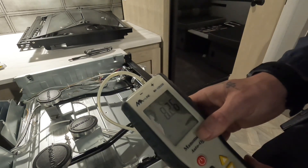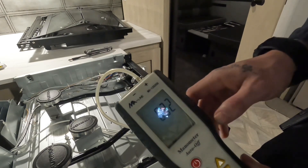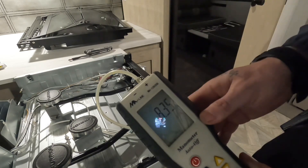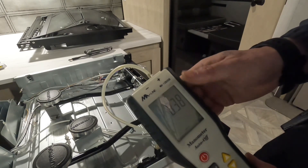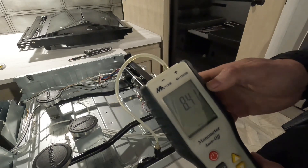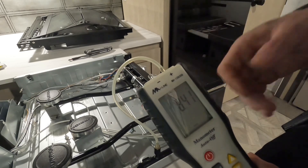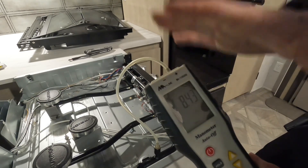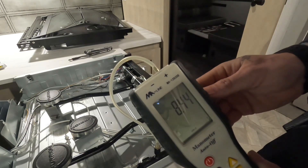All right, we're at the 3-minute mark, and as you can see, we actually went up a little bit, which is fine. Propane is going to expand slightly with temperature variations — this coach came in from the cold into a warmer shop, so things are going to start expanding. You don't want to see drastic drops. You also wouldn't necessarily want to see it go all the way back up to 14, because that may indicate a valve issue on your propane tank or cylinder. But we have verified that this system holds pressure and we do not have any significant leaks.